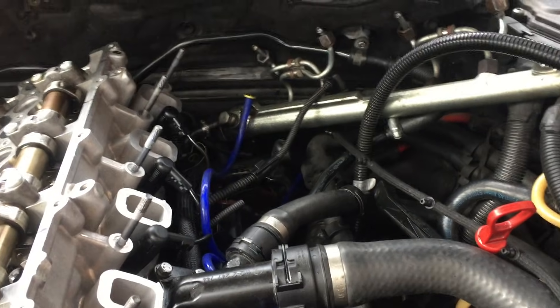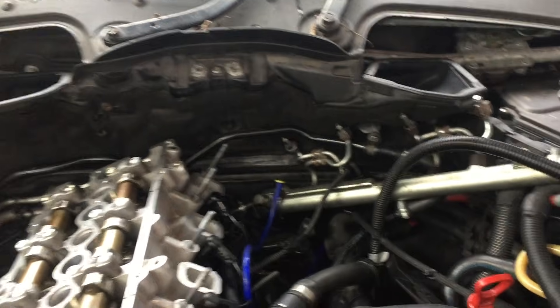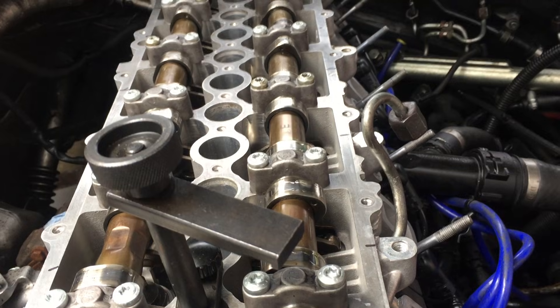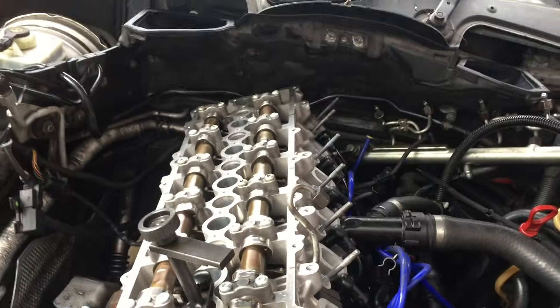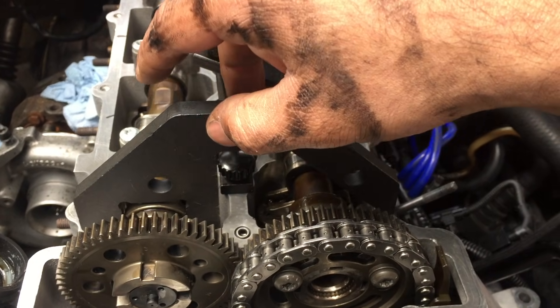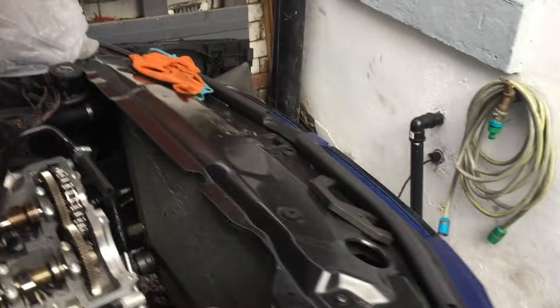There's the pin hole. Okay, we're nearly there now — couple more turns. Now the marks are lined up. Perfect — that should fit easily and sit flat. If I go around here now, those timing marks should be absolutely spot on. There we have it.